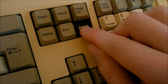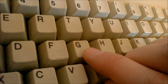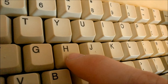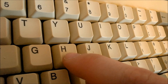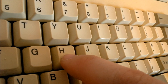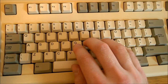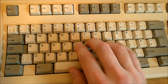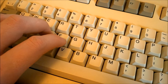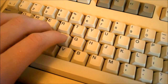This results in shorter travel, a quite different feeling, and a noticeably different sound. The feeling is much more tactile than IBM buckling springs — with IBM's, if you press very deliberately, you can actually push down linearly without suddenly going down after the tactile bump. But this is impossible to do with the Alps design; no matter how careful you are, after the tactile bump you always go down a little bit further. The weighting feels different too — it ramps steeper but ends lower, so confusingly it feels both lighter and heavier at the same time. This is not a switch that encourages light typing, because typing lightly means some keys won't press properly — it really encourages you to hammer the keys.